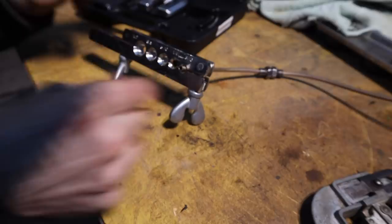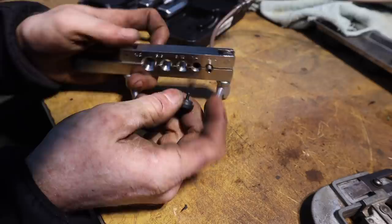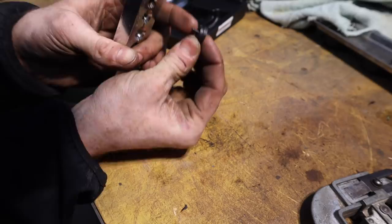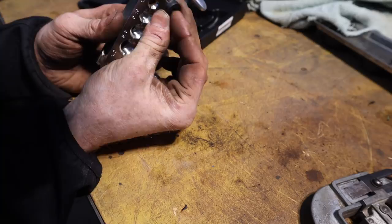When using this copper brake line, the flaring tool you need is a double flaring tool. So basically you've got one of these, it's this vise here, and you want the copper to protrude the distance of whatever size you're using down to the first step. So basically you line that up, make sure this is cut off straight and chamfered on the inside so you don't have any burrs.